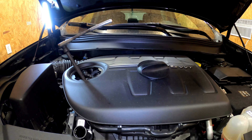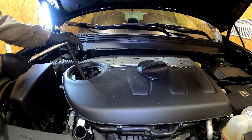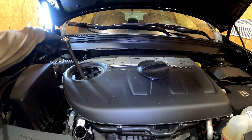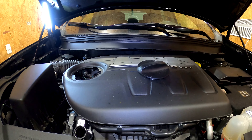Every time we change the oil on our past Jeeps: instant quiet, smooth startups. Once you put your 13 millimeter drain bolt back — I always let mine drain for a really long time, I'm not in a rush, I want to get as much oil out as I can. Put the car back down on the tires and go ahead and change out that filter.